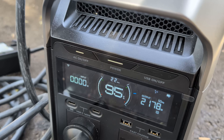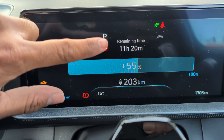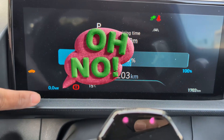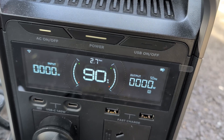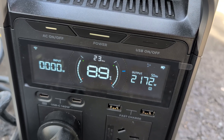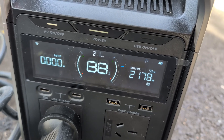Let's see what it looks like inside the car on the status display. Obviously a 1 kilowatt hour power station is not going to last for 11 hours and 20 minutes, but it is charging the car, which is pretty cool. And now we have a problem — it stopped charging. I suspect what happened is the car tried to pull too much from the power station and it couldn't sustain 2.2 kilowatt output for more than a minute or two, so it paused.